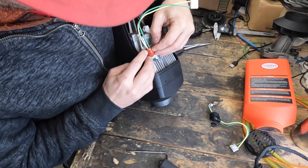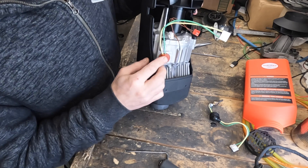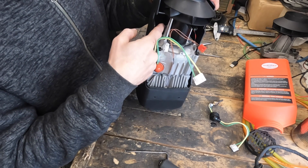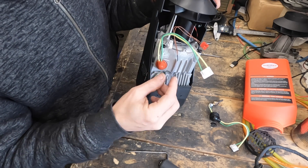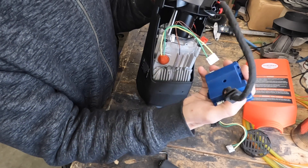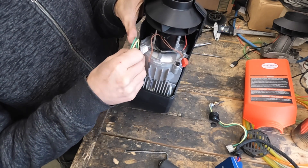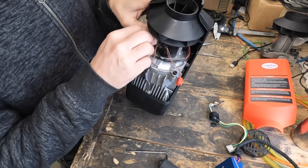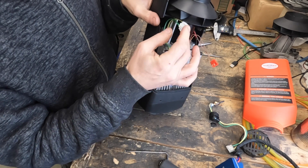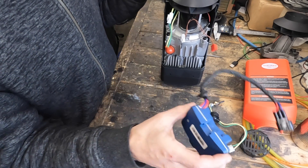The boot is now fully seated in place. I did have to bend the wire slightly at the end of the glow plug, so we're going to pre-bend the wire back into the space so the ECU doesn't have to force it into place — we don't want any strain on the connector itself. Take the wire, push it back in, and give it a little bend so it wants to stay in position.